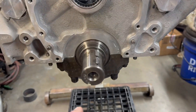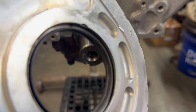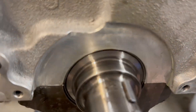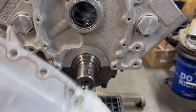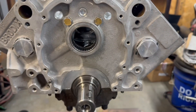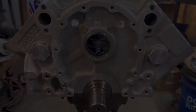We'll go ahead and bolt this on. Once we get it bolted on, we'll install the lower pulley — we'll heat that up real good and get it to slide on. Now this seal here does not seal on the harmonic balancer; this seal seals on the crankshaft, on this lip right here. So you want to put that on dry — no lubrication, no oil — and then we'll slide the cam in, clean the camshaft, get it in there, and then we will degree the camshaft.